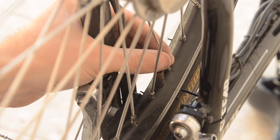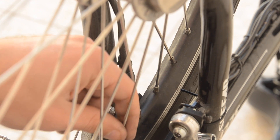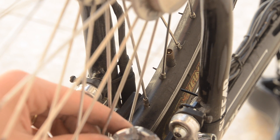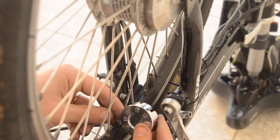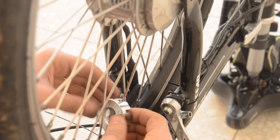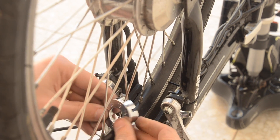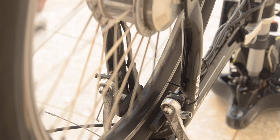I'm going to test again after that first adjustment and see where my new highest spot is. It looks like it's in the same region, so I'm going to try and dial it in. It seems like the middle is about right where the valve is, which is pretty convenient. I'm going to count three spokes in one direction and three spokes in the other direction, counting only the spokes on this side of the hub, and tighten those six spokes. I'm doing about three-quarters of a turn or so. The amount you turn really depends on how far out of true it is — a quarter turn if it's only a little bit, a full turn or turn-and-a-half if it's really out. It looks like we actually made some progress. It's still out of true, but it's closer than it was.